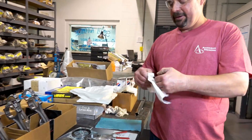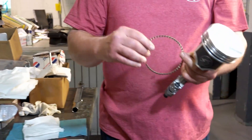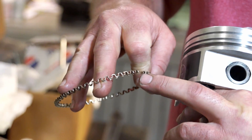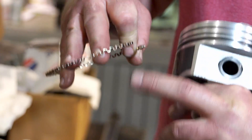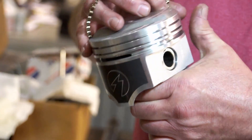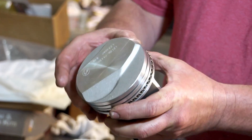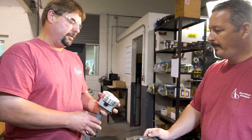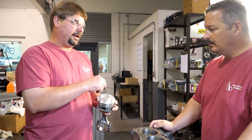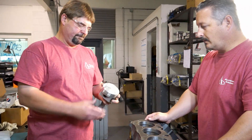The first ring we put on is our oil rings. This is the oil ring expander. The tabs are going down — we recommend that tab go down for sealing. We take them and put it in the big gap on the big ring land on the piston. We're going to put the gaps staggered. We don't want them lined up because that promotes blow-by.